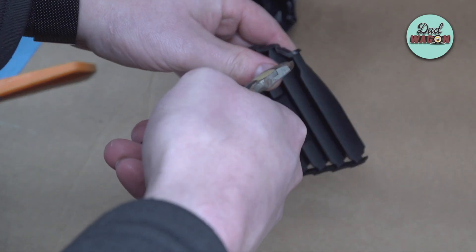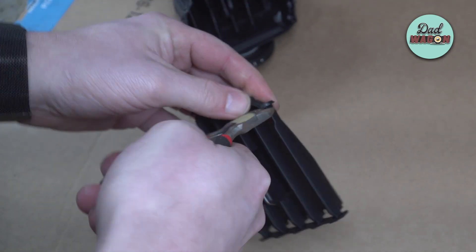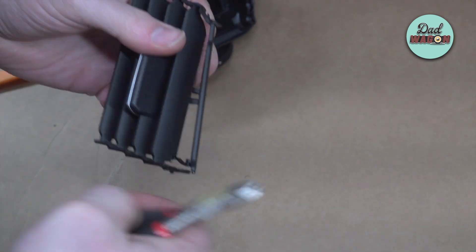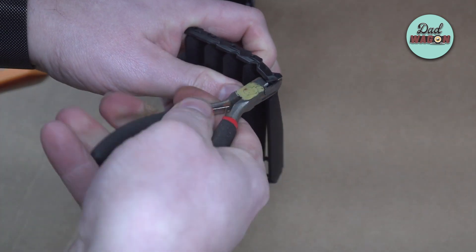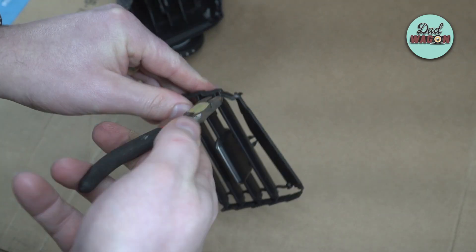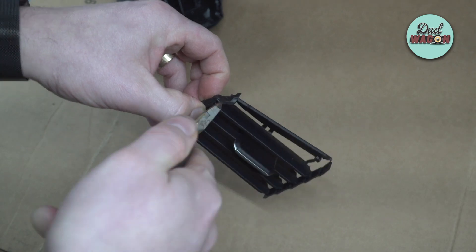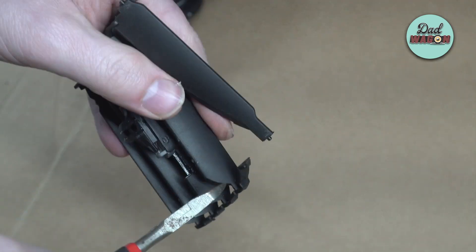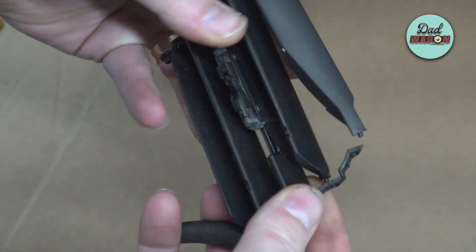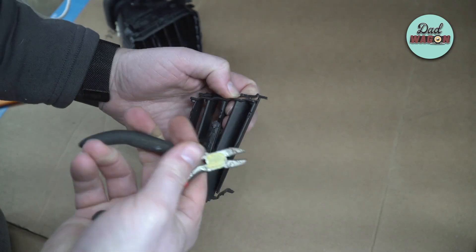Now, in this clip, don't freak out — I am not using these side cutters to cut through the louvers. I'm simply using them to get a grip and put even pressure on the side that holds each louver in, pushing it away without prying and risking snapping the plastic. Just gentle pressure, sliding side to side to help pull those out.